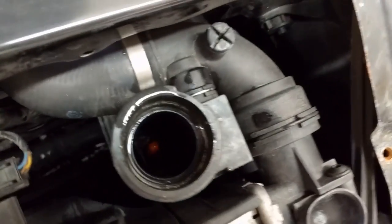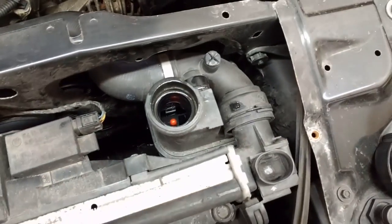After I got home, I did a little visual inspection — put a little bit of distilled water in it to see if there was a leak, and sure enough, the expansion tank had exploded and there were just loads and loads of liquid coolant coming out.